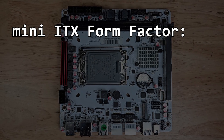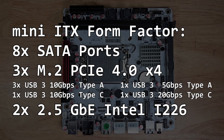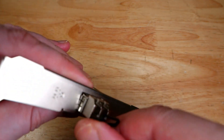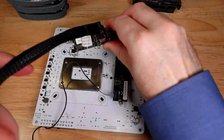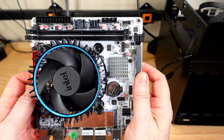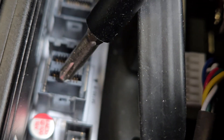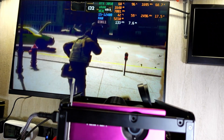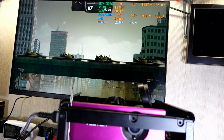If you're looking for an ITX form factor motherboard that can support eight SATA drives, three M.2 SSDs at full PCIe 4.0x4 speeds, multiple USB ports, and dual 2.5GB Ethernet ports, this is a rare find. One feature that would be nice is a 10GB network port, but that's not a deal breaker, and 2.5GB is fine for most use cases. The PCIe slot offers expansion options, and the M.2 slots can also be used for add-in cards, though clearance is a bit limited for SSDs underneath the motherboard. Overall, this motherboard is an amazing value at $239 — it is surprisingly stable, at least the unit I bought directly from the CWWK store — and I don't see any real compromises. The broken SATA connector latch is slightly problematic, but ingenuity can solve that. Longevity and support are open questions, but solid-state components cooled properly tend to last quite a while.